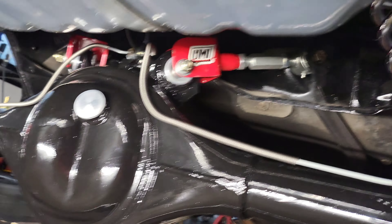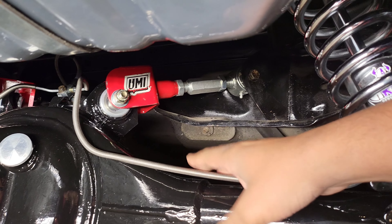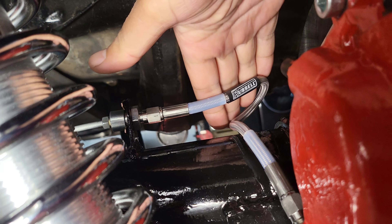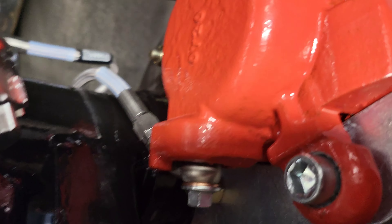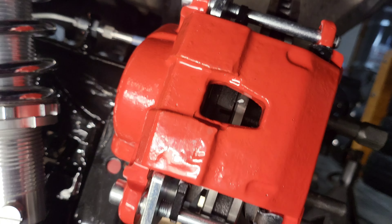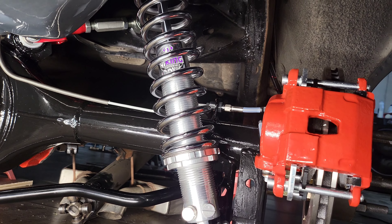This is a 12-bolt, not a nine-inch, so I'm going to cut the ends off and slide the fitting back, re-flare them. The problem I'm having is that's way too hard of an angle — a solid 90. I think I got these from Speedway. I don't want this line on this side of the rear end because the coilovers are going to go off at an angle. If I can get this to kick a 90 out I can run the line and mount up here. The benefit of running flex line here is when you change the center section — the nine-inch just drops out — so you don't have to break your brake lines and re-bleed the system. I'm going to get a 90-degree banjo fitting.